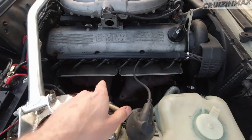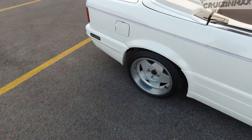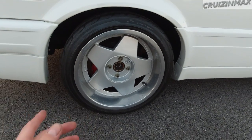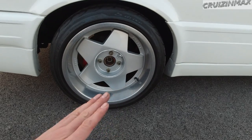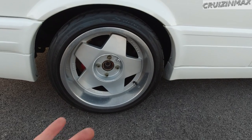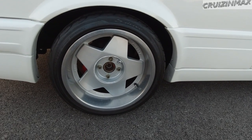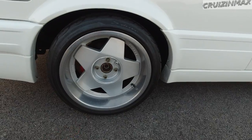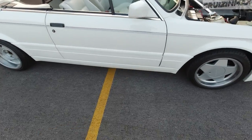It's got copper spark plugs. You want to change those every 20,000 miles or so. The springs in the rear are easy. They're separate from the shocks. I raised it up, obviously, removed the sway bar links, and this lower control arm drops down, and then you can squeeze the spring by hand a little bit and take it out and put it in. The ones that were taken out were easy because they were super short. The ones I was putting in are kind of difficult, but easy enough to put back in. Probably more difficult on the original ones.